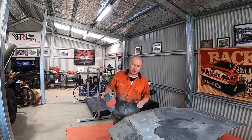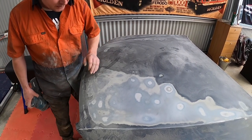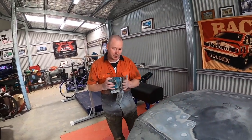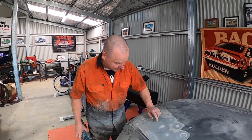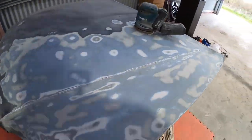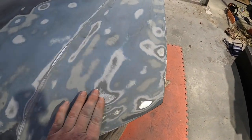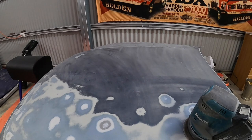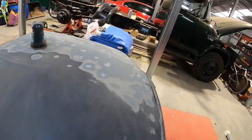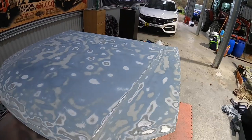The clear is coming off pretty well but it starts to clog up the pads. Because we marked out where those big problem areas were I'm concentrating on them — I've got that scratch area sorted. I won't take it back to a bare metal finish all the way, but it takes a while and you've got to keep changing your pads so they don't get too clogged up. I'm going to get all of it looking down to the undercoat level and then prime and etch it and sand it. We're doing quite a few passes, concentrating on those stone chips and the big scratch, smoothing them out.